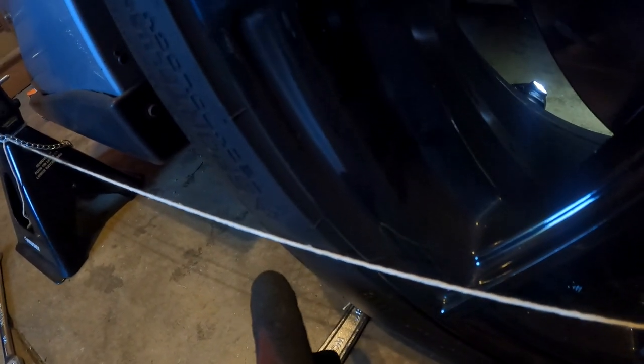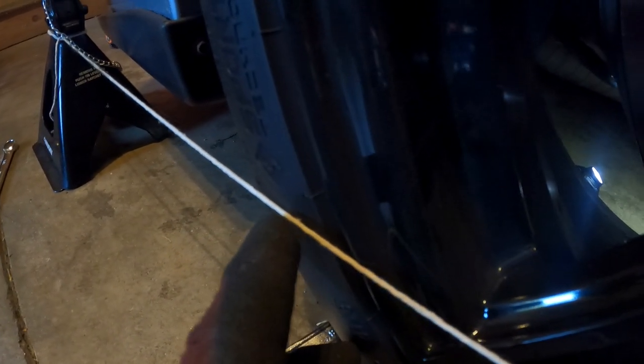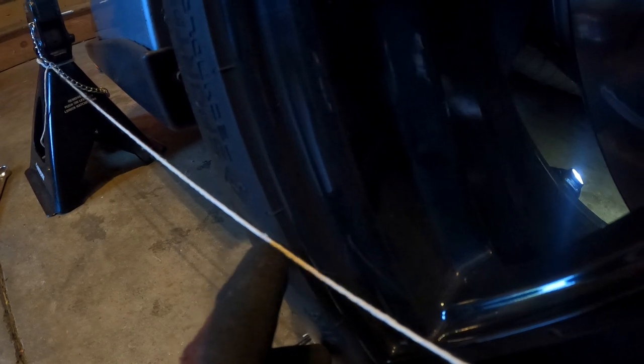So as you guys can see, there's just the slightest little bit of gap. I can move the string in and out, and it's pretty much even on both sides. And that's exactly what you want. That means that string is straight all the way back. It's making light contact on the back wheels too, just that littlest bit of play. And we're good.